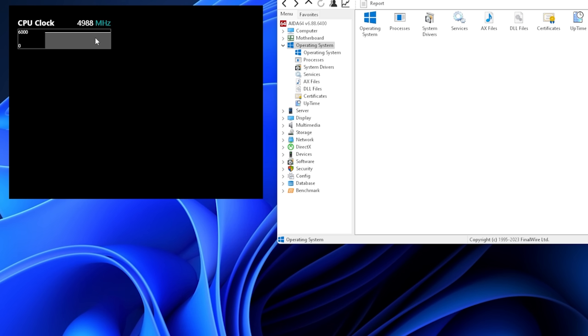The light blue is actually the filling of the bar, and then I just have a dark purple gradient for the 3D bar as the background because this is the color scheme I use at home. I've got my edge temp and hotspot temp of my GPU. Down here is the actual GPU frequency, and then we have FPS down here, plus the FPS chart. If you right-click an item by the way, it tells you what it is — GPU hotspot, memory util, CPU package power. Important note: if you want the FPS to show, you have to have RTSS installed, which is part of MSI Afterburner. So you can install MSI Afterburner and it needs to be running, otherwise it doesn't pull from anywhere. RTSS, or RivaTuner, needs to be installed in order for that to work.